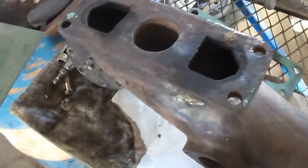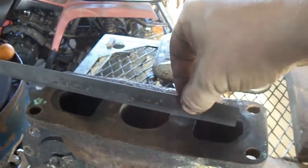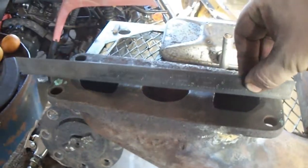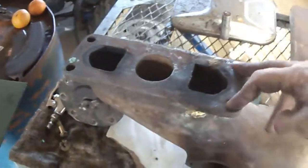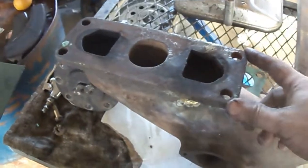We'll use a cut-off axle as a prop and set the manifold up somewhat flat, then put a straight edge across. We don't really see light across there but she won't go over to one side, so we stuck a feeler gauge in and found 35 thou — so she's warped. On these old ones they just run perimeter bolts, unlike later ones where they updated and put more holes through the casting, so they did tend to warp.